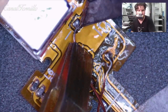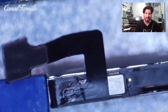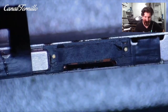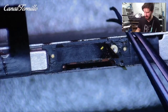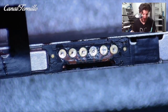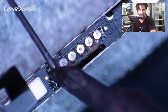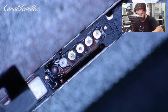Now we go to the Taptic engine. That is a Taptic connector and it is practically impossible to solder there. Fortunately, hidden under the tape there are some test points that will be useful. We carefully remove the tape and expose the test points. The terminals to connect with the Taptic coils are the ends, and to them we must solder the cables that come from the terminals of the clicker.